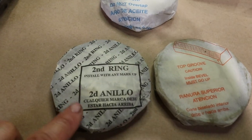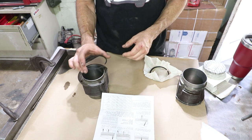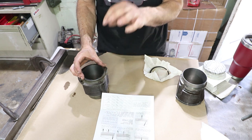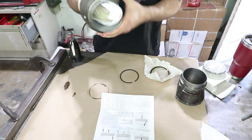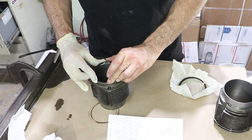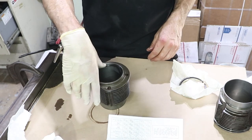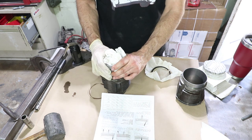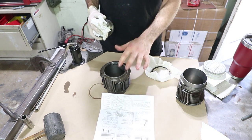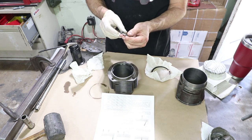There's the oil rings, this is the number two ring, and this is the top ring. These rings are cast iron, as well as these cylinders which are also cast iron. The trick to do here is to install these into the cylinders and check the end gap at both the top and the bottom of its travel. Start by making sure these are pretty clean. Let me plop the piston in there — that's about five or ten percent down from the very top, so it's within its normal range of motion. Now we just measure with the feeler gauge and see how big that gap is. I got three feeler gauges in there: 24, 23, and 22 — so that's 69 thousandths.